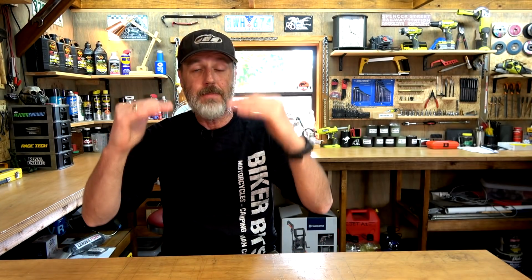Let's do it. Right, starting at the top, for me the top is the fuel. Fuel goes bad, we know that, you can't deny that. Fuel goes bad. Right, so two things that you can do. Drain all the fuel out of the system. Now remember, I'm going to go into more detail after I run through this, because there are different things like fuel injected bikes, carburetor bikes. But drain all the fuel out of the system, not just the tank, and you're all sweet. Or fill the tank up right to the brim, add some fuel stabilizer in it, and you're all good to go.